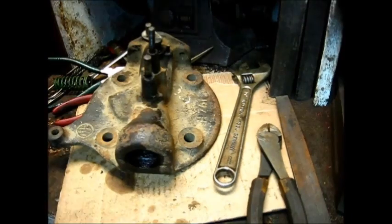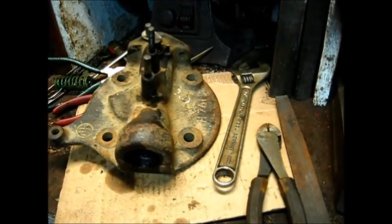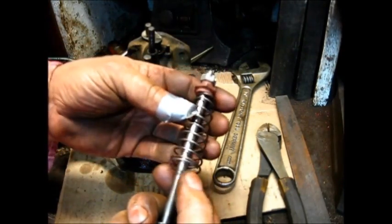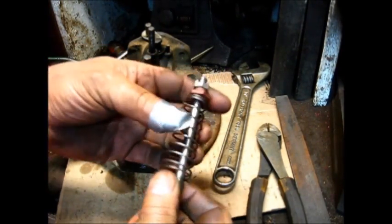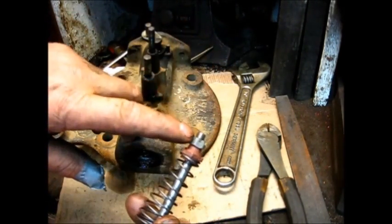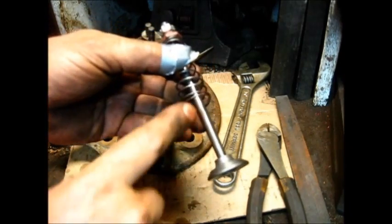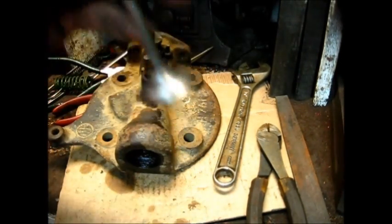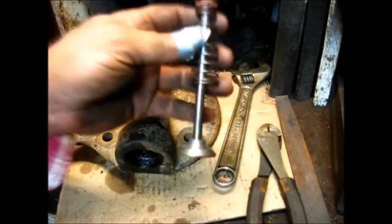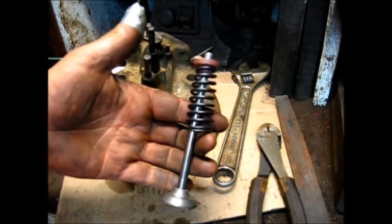So I will put a new spring on there. Just to come into play right now — this is the new spring. You see how they made that extra half a loop around there so it'll set flat. The top is the same way — fits up like that. This is the correct type nut on the top: castellated with a cotter through yonder. Cast iron head, steel shaft. It's very good. These are available for order — hit and miss, good company to deal with.